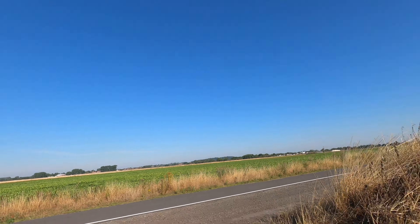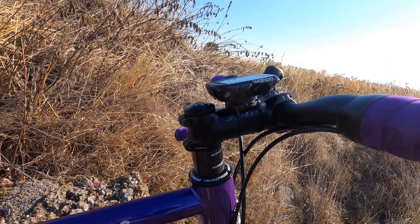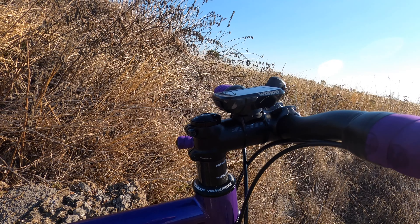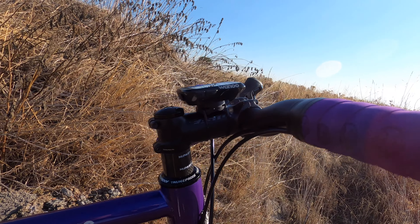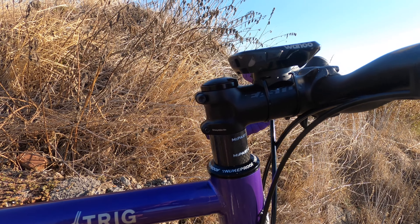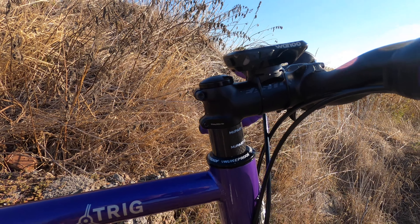So a quick pit stop and I'll show you some of the things I've done. If you look on the stem, you'll notice I've put a 5mm spacer just below the top cap. The reason for that is I didn't realise when I put the initial one on — in the third video — that it's convex, so it wasn't sitting flush with the top of the stem. I just put the spacer in there, tightened it down, and that's gone on really well. And those carbon spacers below — believe it or not, I found those in my toolbox still in wrappers. I bought them about 2005 — 17 years old — but I finally found a place on the bike.